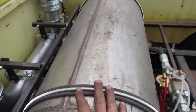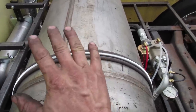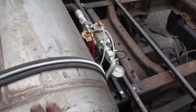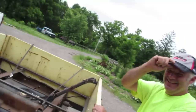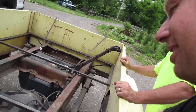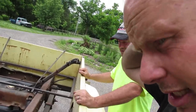So this tank is just the reserve for the starter and nothing else. But when it's empty, you can't start. Oh yeah, not nothing else, also the air horns, but don't forget the most important thing. Well, you'd rather blow your horns than start. No. It only drops at about 10 pounds to start it. Well, you need at least 75 to start it, so we'll turn that up a little bit, and then we're good to go.